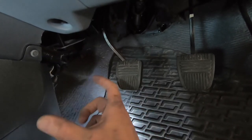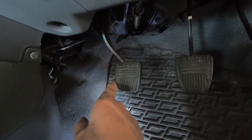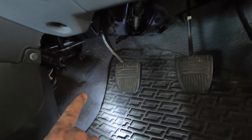Basically up inside here there's a threaded rod with a lock nut on it, and that threaded rod is what actually pushes on the master cylinder. So we'll just have a quick look up in here. It's obviously a bit difficult to find or show things, but like I say, it's probably going to be impossible to show you, but it would appear that our lock nut is there for sort of decorative purposes at the moment, because it's not actually locking anything to anything.